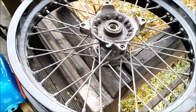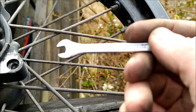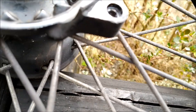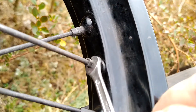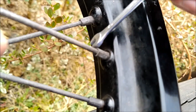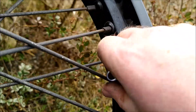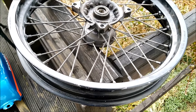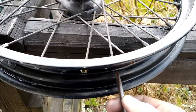I've noticed on this set I've got a little 6-millimeter spanner and it seems to fit on the nipples quite well and undoes them. The recording stopped for a moment, but I've got this little 6-millimeter spanner and it works extremely well - this wheel hasn't been painted. I'll slacken all these off and see what I've got to work with. I have no idea what this wheel is off - I got it with the donor bike for the rebuild.